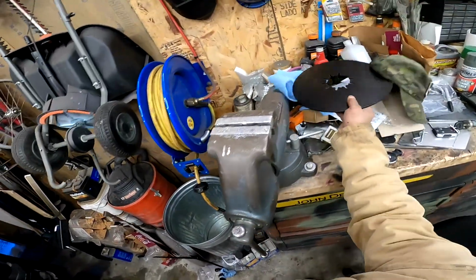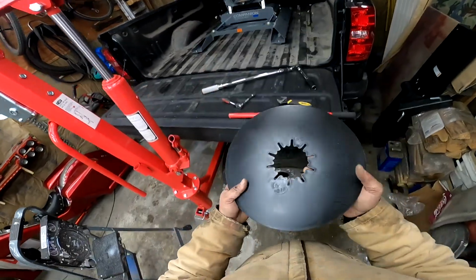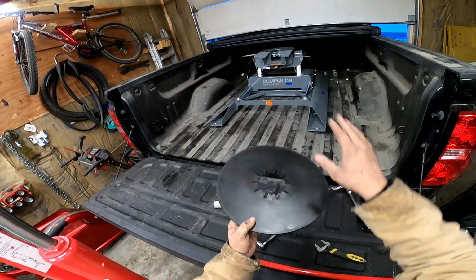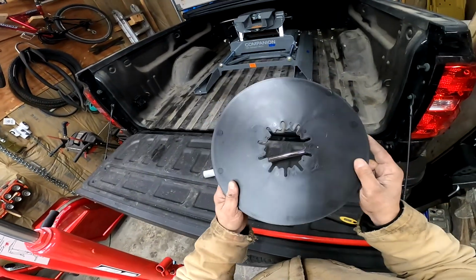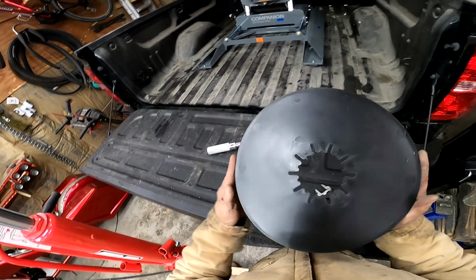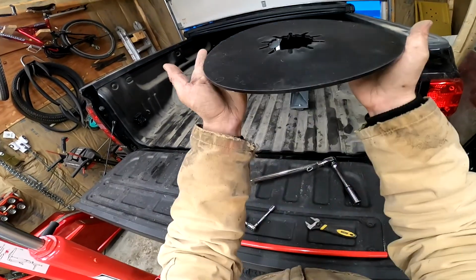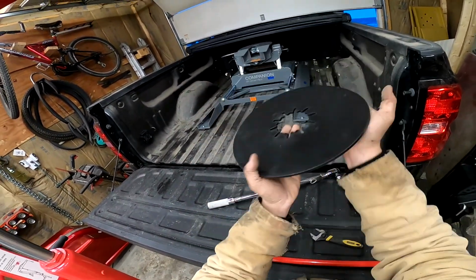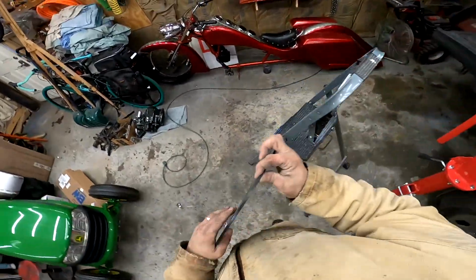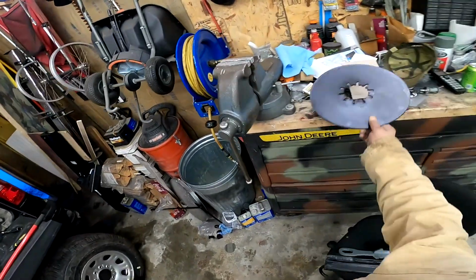And then one other thing, this will go on the 5th wheel, the kingpin itself, and this will be the lubricant. Otherwise, it tells you grease that real good. I don't want to grease it. Grease is messy, ugly, and then I have to actually use grease. This is plastic, some kind of plastic or nylon, and that's what it's made for. It's wear, so that way this wears, not the metal. This is your lubricant. Also, it's thicker, so if there's any play, guess what? That'll take care of that. So that's that problem solved.